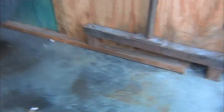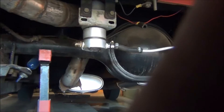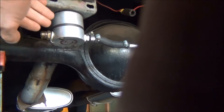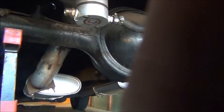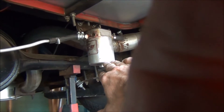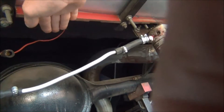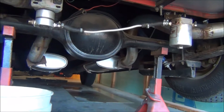Another thing that's wrong with this system is the fuel pump is right next to the exhaust pipe, which means the electric motor is probably seeing a lot of heat, even though this is a tail pipe and it may not get that hot — then again, maybe it does. We're going to mount this pump and the original Fram filter all on one mounting plate, hook them together, and put it in the middle, as far away from the heat as I can possibly get it.